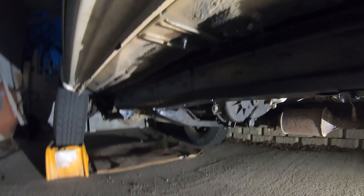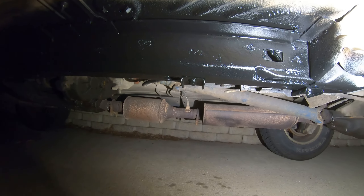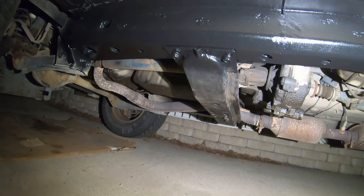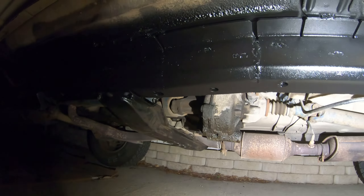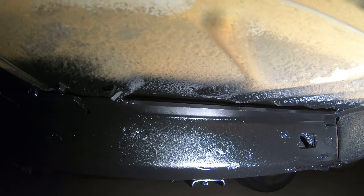So that last one was about 17 mils — right where we wanted it to be. I know you're not going to be able to see anything because the light's on the wrong side; I'll carry the light around with me. I'm not a very good painter, and that stuff goes on really, really well. It's really forgiving, so all the stupid little mistakes I made, it just kind of self-levels and takes care of it. This coating is the main coating, but you can see probably a couple little areas where it's not completely covered.